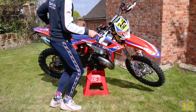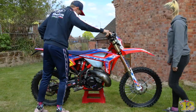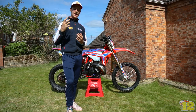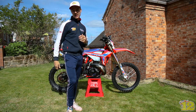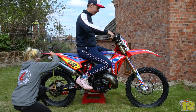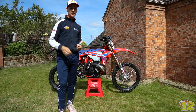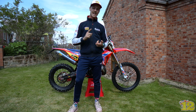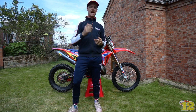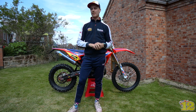Get the bike off the stand, sit on the bike, and get someone to hold it upright so all your body weight is on it. This is best done with all your kit on so the weight is more accurate, but you can do it without. Get someone to measure the exact same point from the swingarm or axle up to the mudguard or silencer, making sure both measurements are taken from the same place. Whether you're running a linkage rear shock or a PDS rear shock, that spring rate measurement will vary, so check your manufacturer specifications to see if you're in the right ballpark.